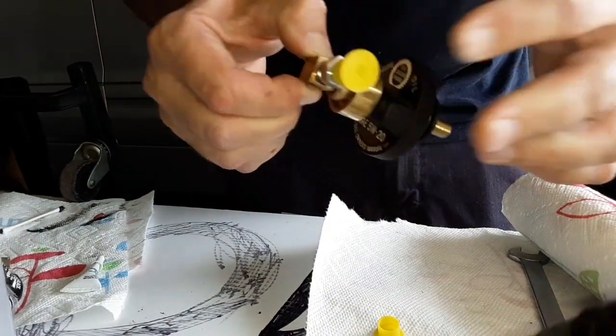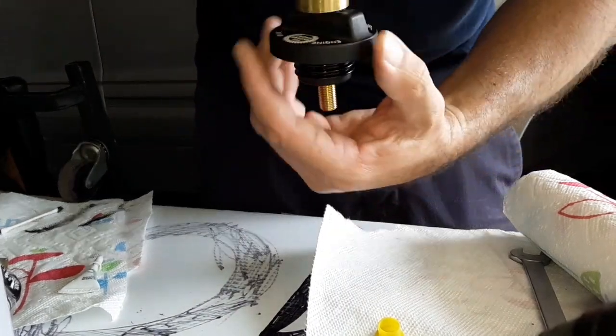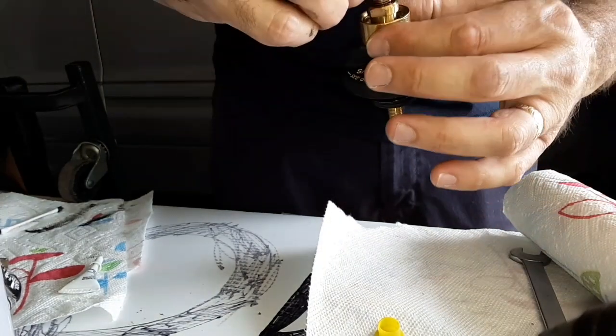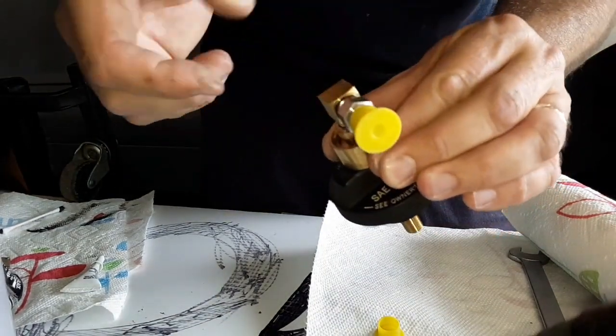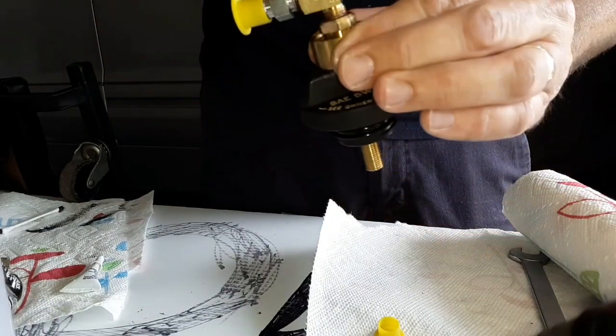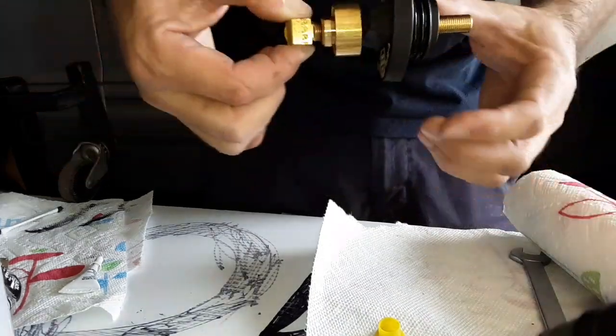Here's my finished product — the oil fill cap. The RTV is going to continue to set up and dry. It says 24 hours before putting it in service, but this isn't like an oil pan gasket where there's constant oil against it — it's just oil coming out of here, so by the time I'm done it'll probably be long enough. I put my angle fitting and JIC fitting in — this will be ready to connect to the hose with the clean oil coming from the bypass filter. It's a swivel fitting, so you'll be able to turn your oil cap with the hose attached.